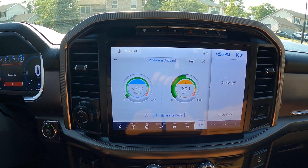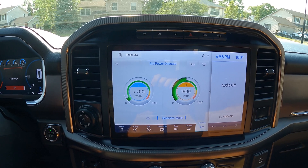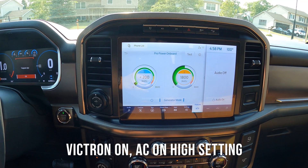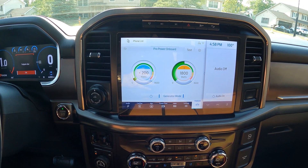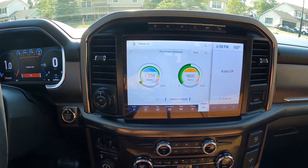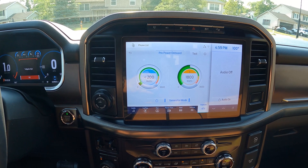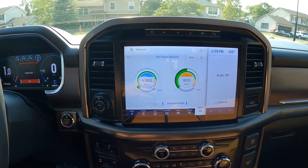Comparing low mode to medium: 12.5 amps versus 14 amps. We increased the air conditioner from medium to high cool mode, and we're still at about 1800 watts — about 15 amps. Not much additional load or additional draw going from medium to high.